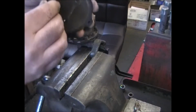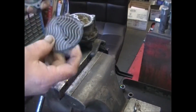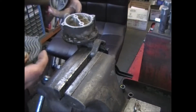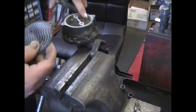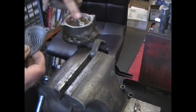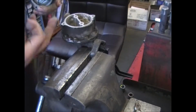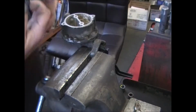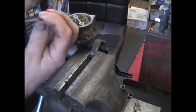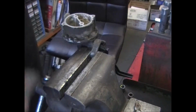This is your pulsator diaphragm. What this does is block off the fuel when it comes in. The fuel will go in, and this just directs it so it keeps it from going back and forth. Once it's down inside the pump and the diaphragm pushes it back up to force the fuel out, it'll hit this here and send it out through the outlet up to your carburetor.